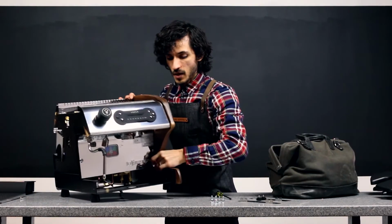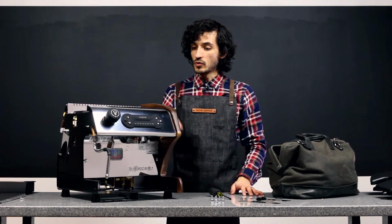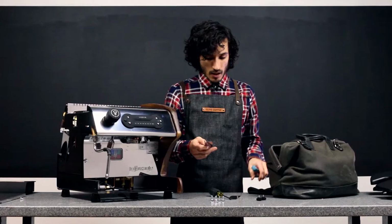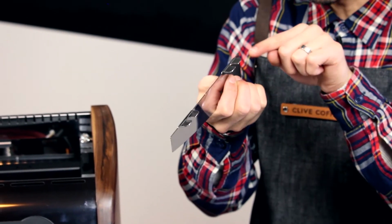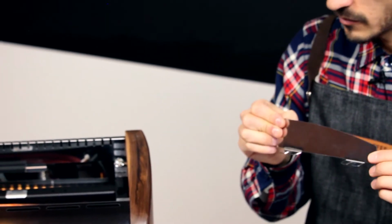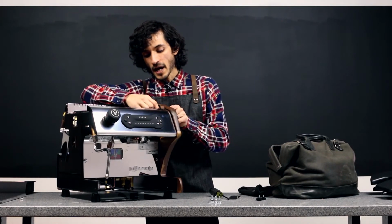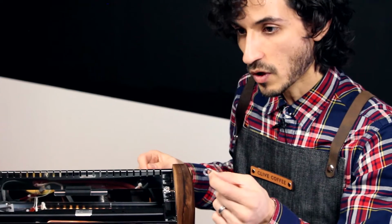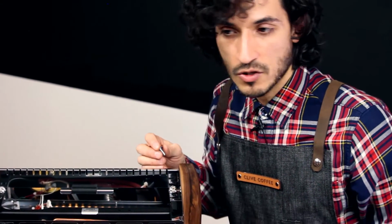And we'll gently place it back. And now we're ready to put the screws back in place for our top panel. Before we put the mirror piece back in place, to make this as easy as possible, I'm going to gently bend the tabs so that they have a little bit of an angle going outward. You'll notice that the tab and the machine, if there's a little bit of extra space, you could use an additional crush washer. Our machine today has a tighter tolerance, so that's not necessary.